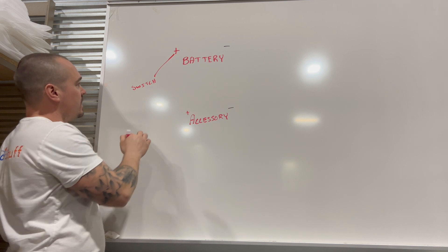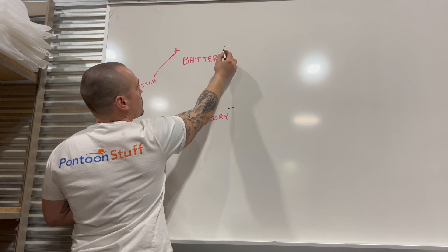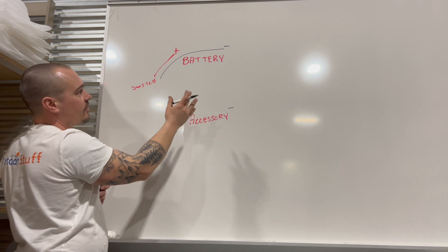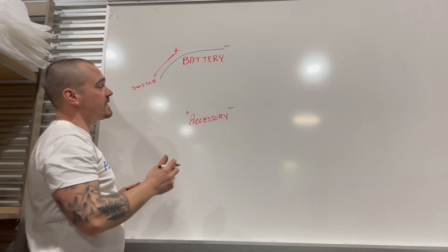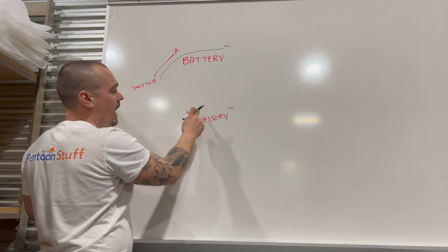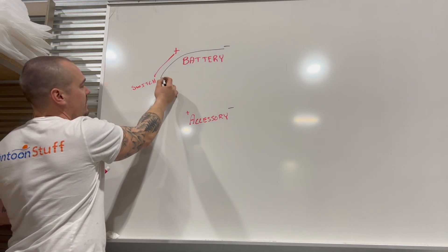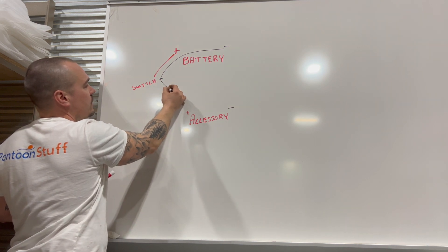For practical purposes, I'm going to run a power wire to a switch. In the off position, the power just ends here. With some switches, the ground may come to the switch and then jump out from there. In other cases, the ground might be shared among a bunch of accessories. Eventually it just has to get to the accessory — so in this case our ground is wired to the switch, but essentially it's just a connection point and then it can go out to the accessory.